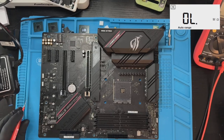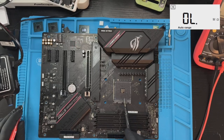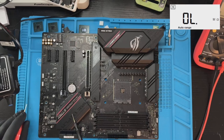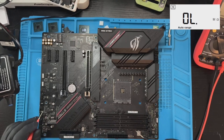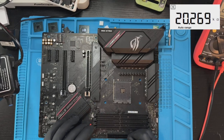We can clearly see three large coils on the board. This coil looks like the DDR power line, also known as VPP — it should be 2.5 volts when the motherboard is powered on. This largest coil is probably VDDQ, responsible for supplying voltage to the memory interface, going directly into memory and the CPU slot. This other coil is probably the chipset power line, which is 1.8 volts or 1.05 volts. Let's measure them — VPP is kilo-ohms. Nice.